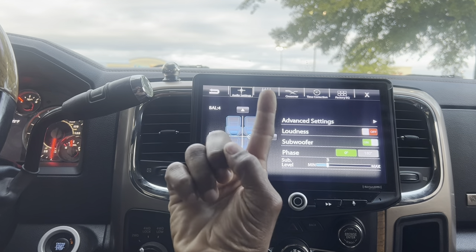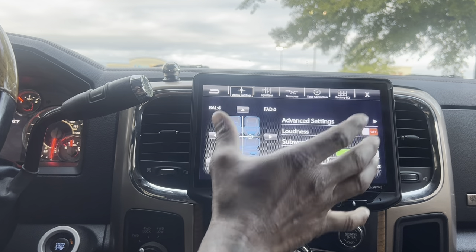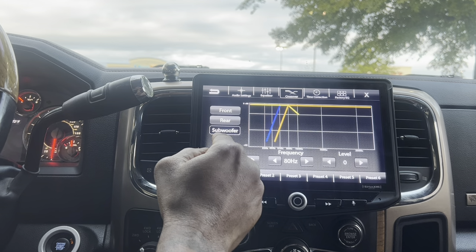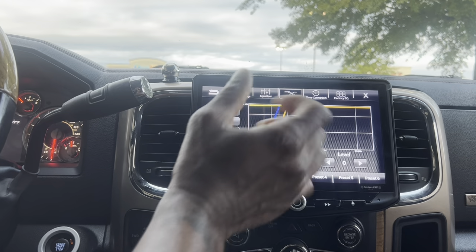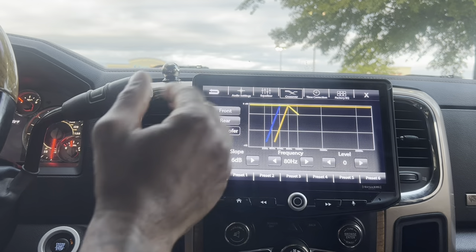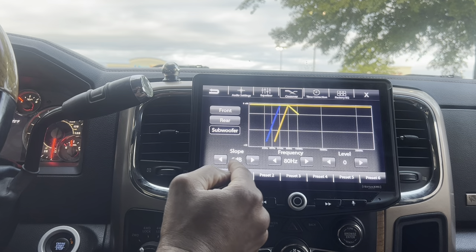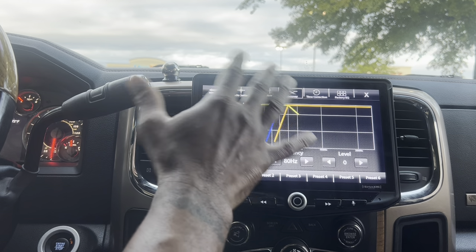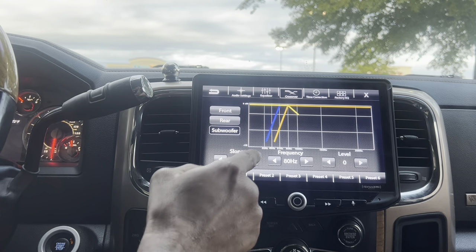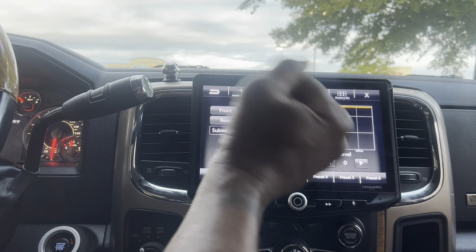That's the MBE way — always get more power than you need so you can dial it back and have headroom, whether it's your sub, your amplifier, or your mids and highs. So my crossover setting on my subwoofer is set at 80 hertz. On my amplifier, it's bypassed — wide open. But it's only going to receive 80 hertz and under, with a roll-off because my slope is 6 dB. I have very little mids coming through — from 100 hertz to 80, attenuated 6 dB — that can come through into my subwoofer, but you're not really going to hear that at all.